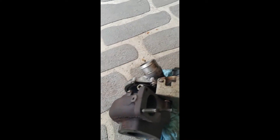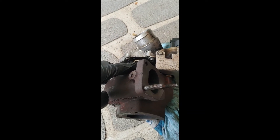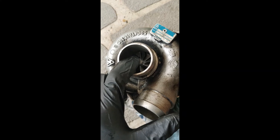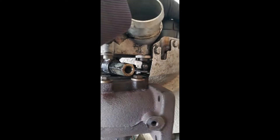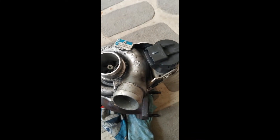One test for that: let me put it in a better position. I put some oil in it just to be on the safe side since I'm going to reuse this turbo. What you need to do is use a normal hairdryer and push air through the inlet of the exhaust side — the air will come out the other end as compressed air at the compressor outlet. We'll watch that end and see how the rotation speed changes when we manually move the linkage from one extreme to the other.